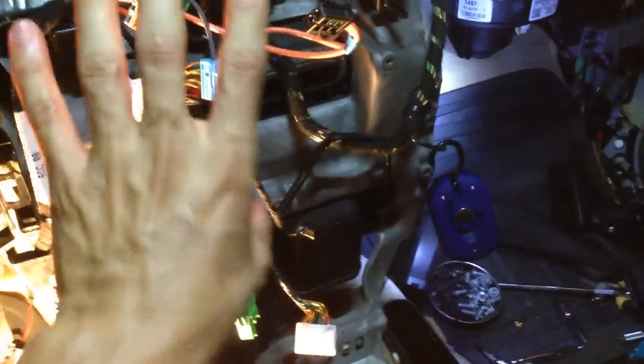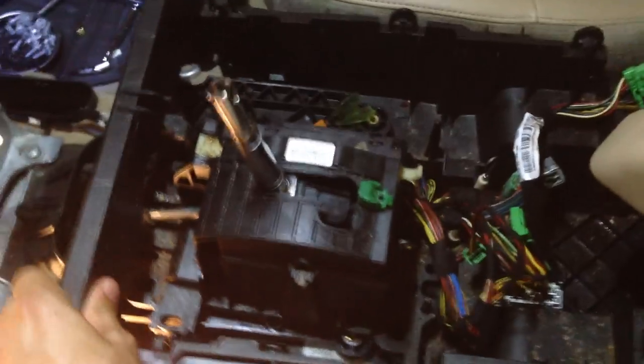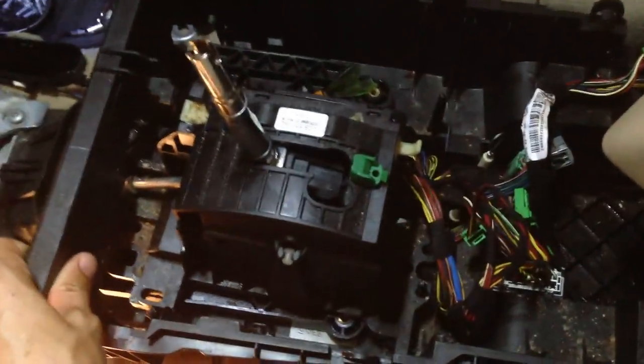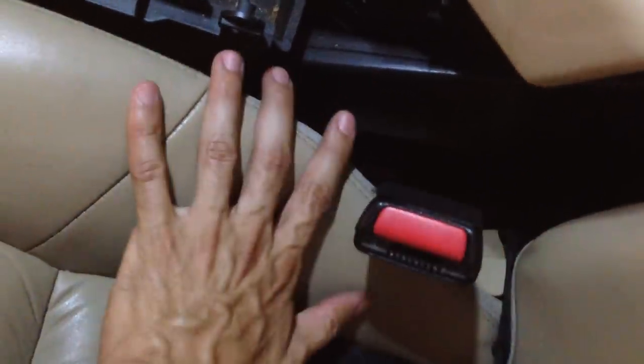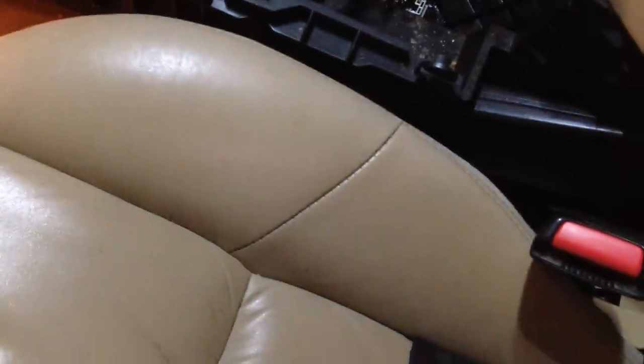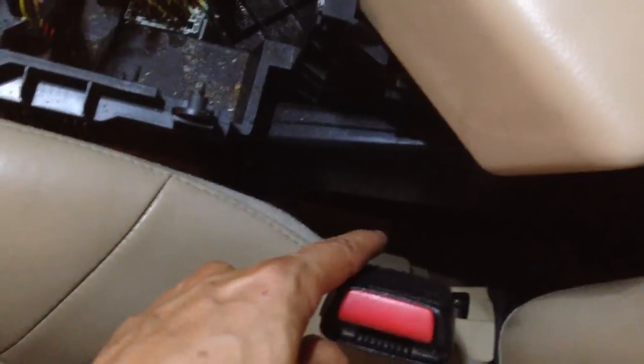There's a plastic casing that holds your radio, your air conditioning controls, your navigation system, and so on — a plastic frame casing like this right here. Before you take this off, you have to unbolt this entire unit. Take out your refrigerator, take all this stuff out, take your fascias off on the sides to get to the bolts down here. You're going to have to slide your seats all the way forward and recline the seat forward, because there's a bolt on the side down here on both driver side and passenger side.